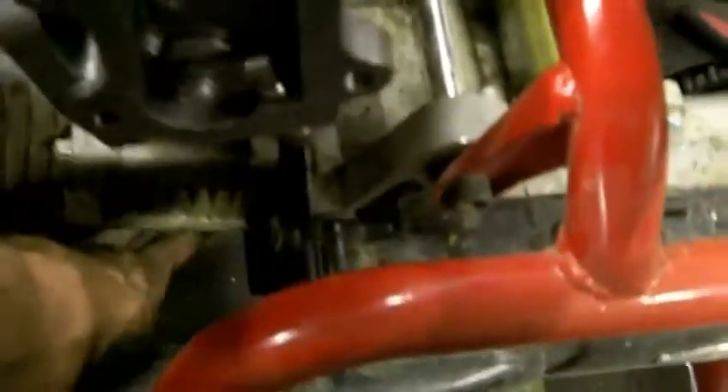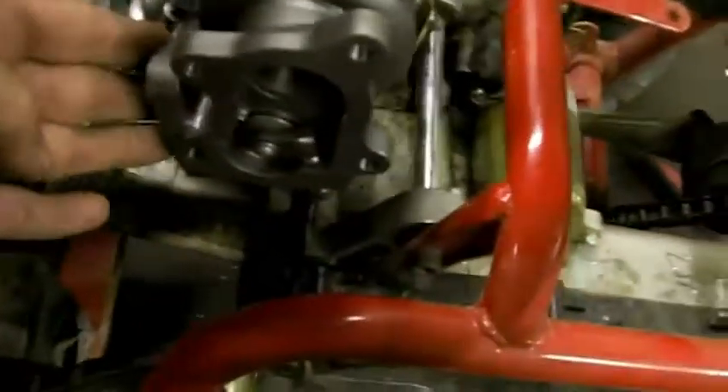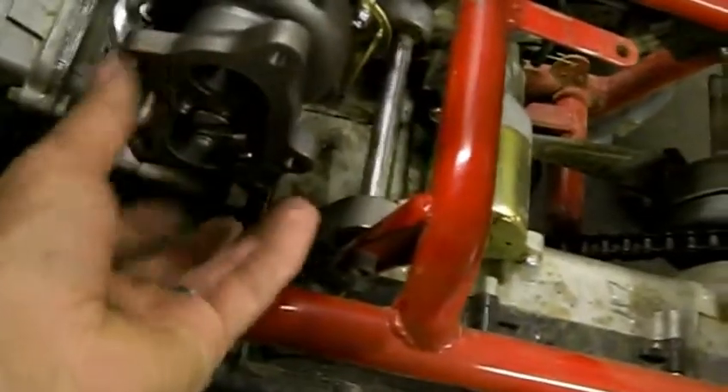The drain will be done next. That's going to drain back into the valve cover, and then all that's left is to fabricate the exhaust pipe to come up around through here and into here to feed the turbo exhaust, and then fabricate a plate to run a muffler somewhere down in this location. That's how far we got so far today.